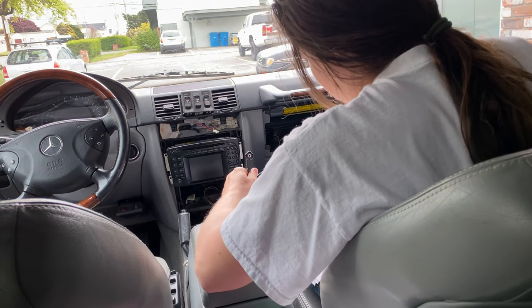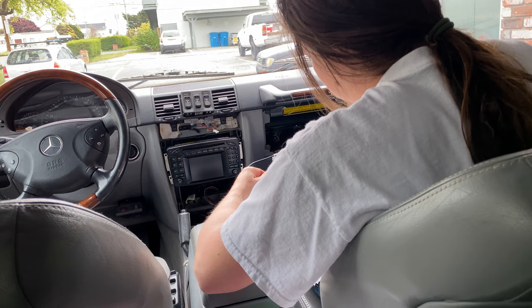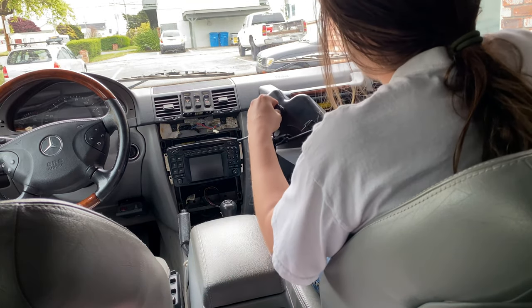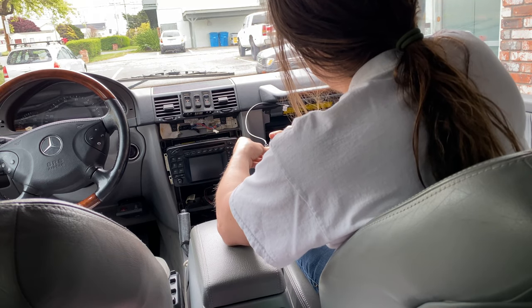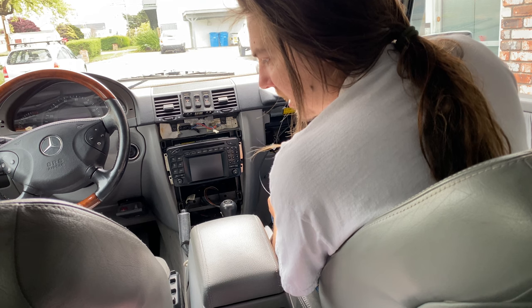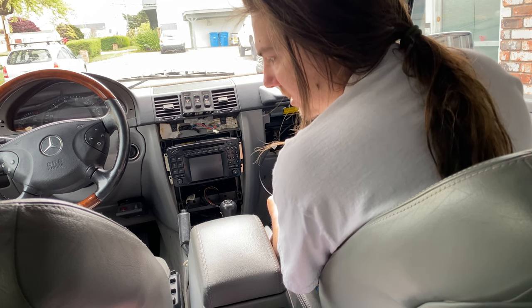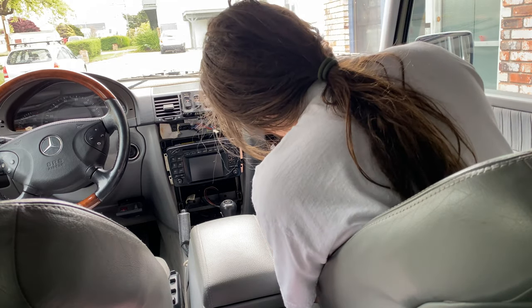And we're going to insert the auxiliary connector into the drill hole from outside. Be sure the edge of the glove compartment hole inserts into the groove in the connector. Looks like our hole is roughly the right size. Boom. Wants us to face it that way. Okay. From inside the glove compartment, lock the connector in place by inserting the quick release connector into the connector face. Be sure the spines of the quick release lock insert into the corresponding notches in the connector.